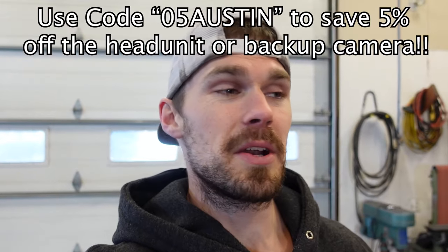And one thing about those tweeters is they come with so many different mounts. I was able to use one of the mount buckets and bolt it or screw it right onto the factory mount for the 4Runner. Bolt them right in and I didn't have to do any modifications. The only real modification I had to do was build that adapter plate for the rear speakers just because we went to a bigger speaker.